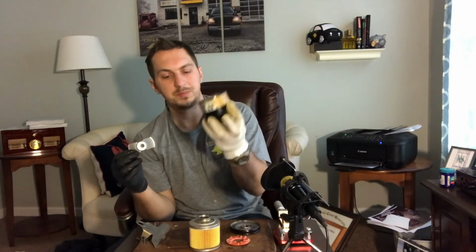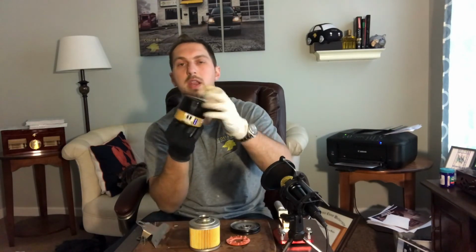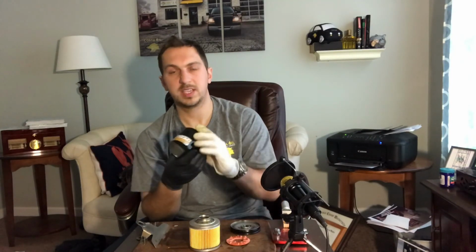The steel coil spring is separate from the rest of the filter. It's in the housing, the oil filter housing, which is a steel filter housing. This Mobil 1 has the pleats on the end, just like the Motorcraft and the PZ21, for easy removal or easy application. Now, this has instructions built into the label on how to remove the filter, but it doesn't have a cross-reference.